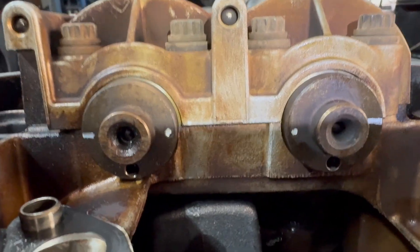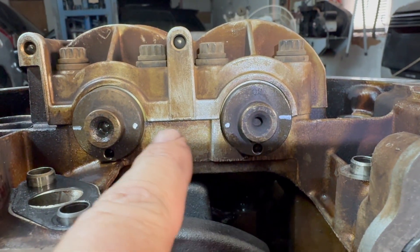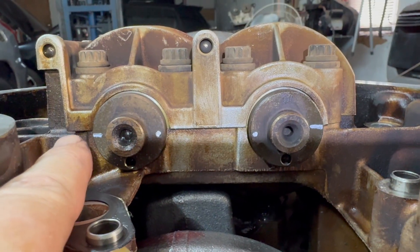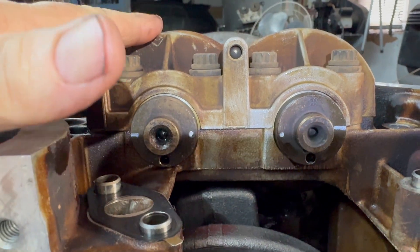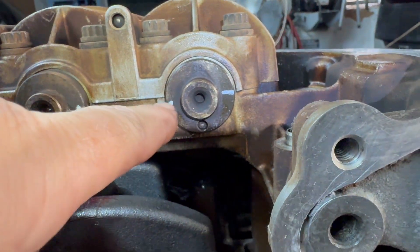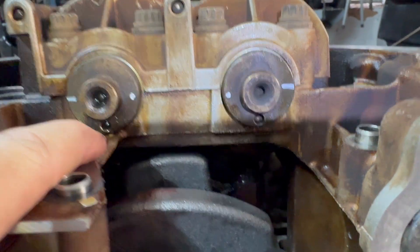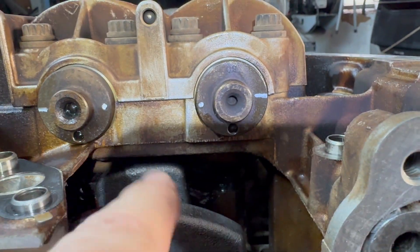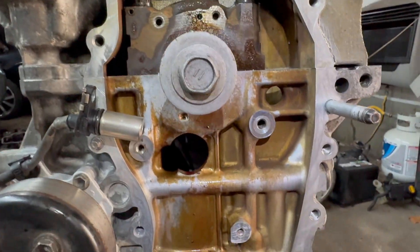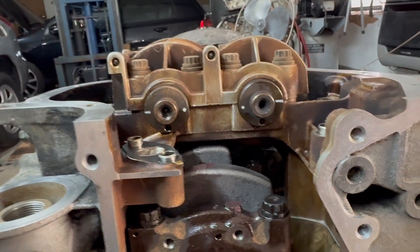The circle and the circle have to line up like that. The line over here has to mate with the top of the cradle and the counterbalance casing and the seam here where it mounts. You see this seam? And the same thing on that side. So the lines have to line up, these dots have to be like that, and these circle indents over here have to line up just like that. That's exactly how you want it.